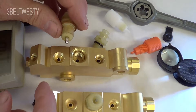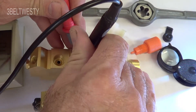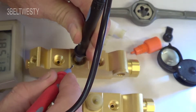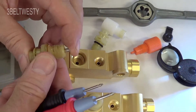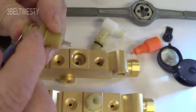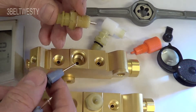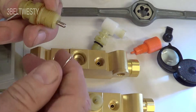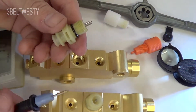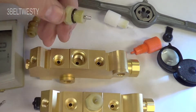This switch — when the spool goes back and forth — I've got an ohmmeter hooked up. The spool inside is isolated and not touching the switch contact. What's happening is this has a spring load on it, and when it's out of the unit it's not connected. If I compress this — so this is actually a switch — I first thought it was always touching the spool, but the spool held with o-rings is not touching. So this makes more sense: it actually pushes on this and makes the contact.